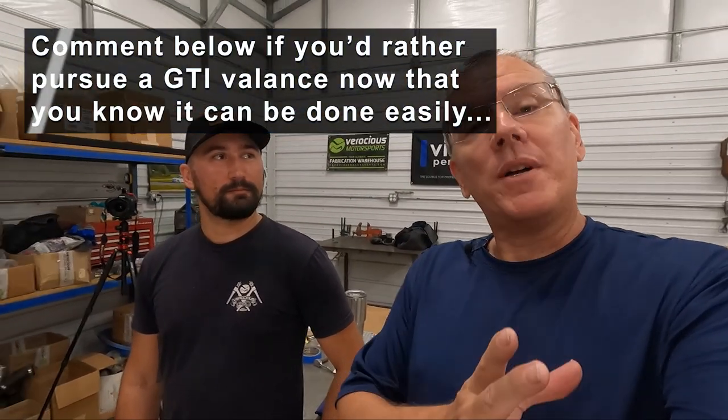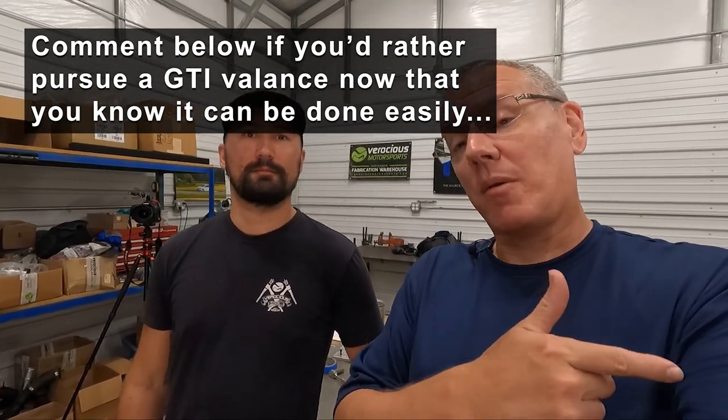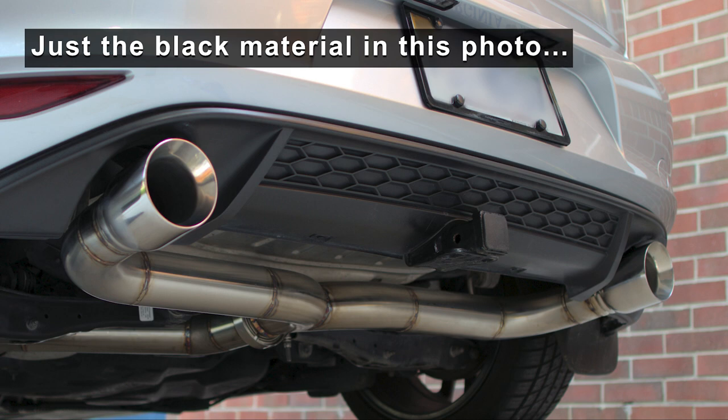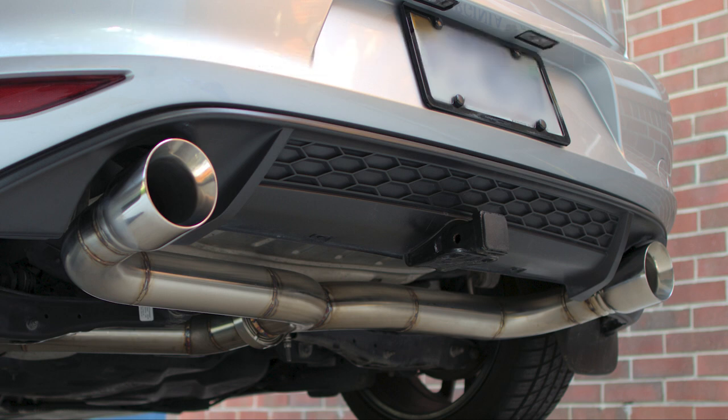Back to the GTI valance — if it's in your budget to swap out just the rear valance, not the whole bumper, you can go right with the GTI exhaust with the dual tip cutout. No painting or anything is required either since it's an unpainted piece. The Golf R is not interchangeable, so if you want to go from a Golf or GTI to quad tips you'd need to go aftermarket. Also, Mark 7 and 7.5 are not interchangeable — 2018 and newer, the facelifted exhaust tips are an inch further apart and the bumper cover itself is different. Mark 7s stick with Mark 7s, 7.5s with those — no cross-pollination.